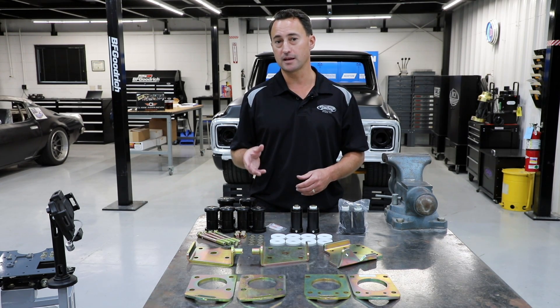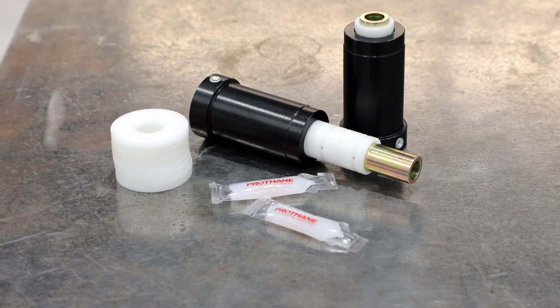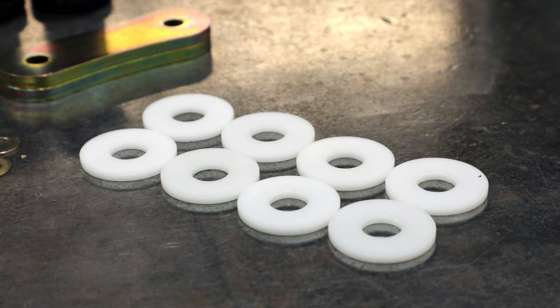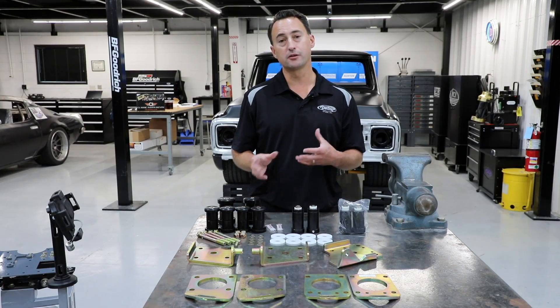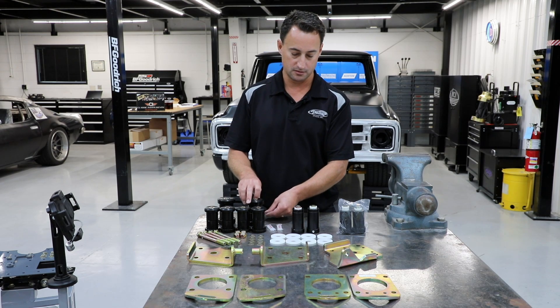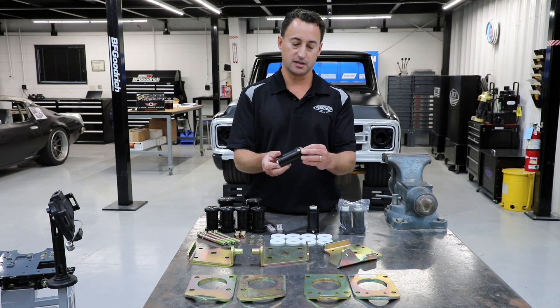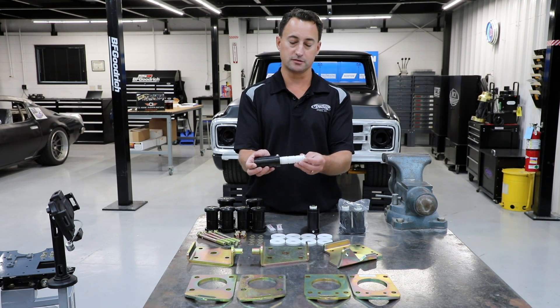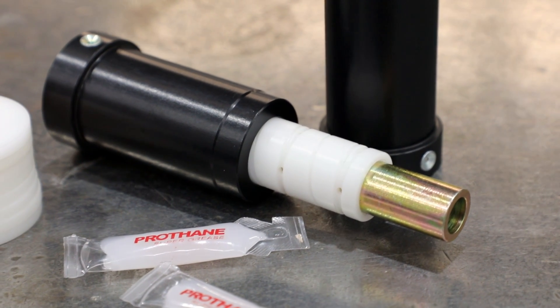One cool thing — even if you're not mini-tubbing it — the way we've designed the bushing and the flanges, it's actually going to offset the leaf spring a little bit inboard to give you that extra tire clearance in the back. Included in either the urethane or the delrin bushings is an zinc-plated crush tube. With the delrin bushings, you can see they are greasable — there's a nice crush tube as well as a delrin sleeve that has grooves in it to help maintain that grease in the bushings.